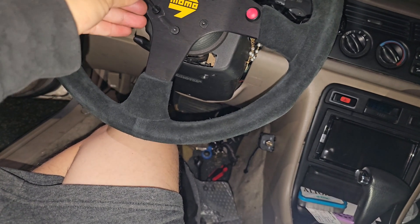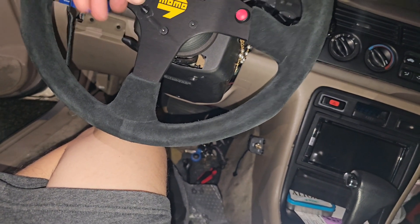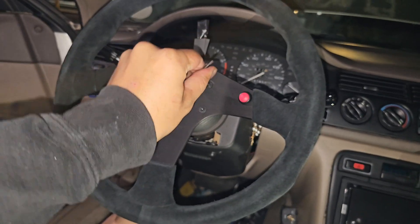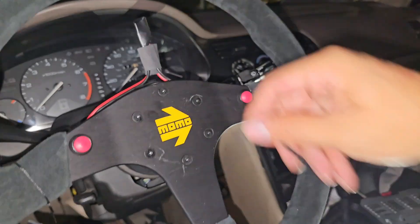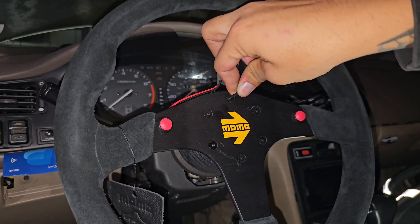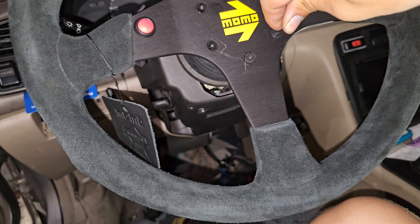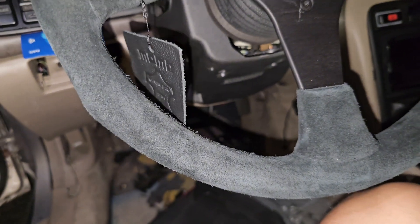The tools they provide are cheap little Allen head sockets. You should use Loctite on this since it might come off with road use, but this is a first step in modding the vehicle — no judging. We're gonna keep tightening down. Going in again with the star pattern, working away from the top and doing a full 90 degrees. Regardless of anything, always work in a star pattern — don't over-torque it and don't push too much pressure because you don't want to snap anything.